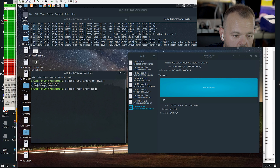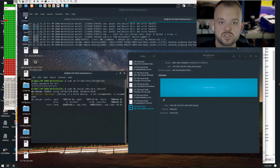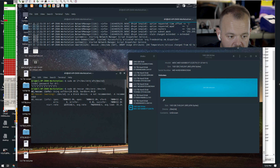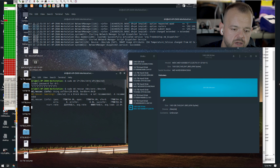With dd_rescue, you don't need 'if=' — you can just type it in and hit Enter and it will give you progress. What it's doing is taking /dev/zero and writing all zeros into the drive. The good thing about dd_rescue is you can see the progress. You can also show progress in dd, I just didn't feel like going through the command prompt for it. We're going to let that finish and then look at both drives to verify they're actually wiped.